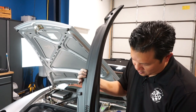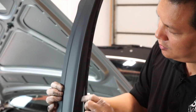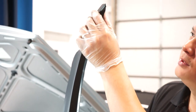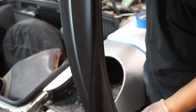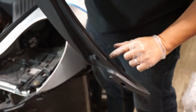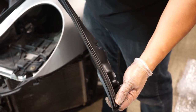We've transferred the rubber trim piece to the new cowl. Make sure you push it in — you'll see how it kind of falls into a channel. It doesn't clip in place, but it falls into place and you'll see that it sits nice and flush. When it gets to the end, it kind of follows a different direction, but it still has a track which it falls into. Just be careful with that.